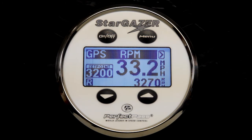The system has taken over. The RPM should quickly lock and hold within about three seconds of the engagement beep, and should hold ideally at 3200 to 3210 — it should hold on the high side. If it does this, it would indicate your linkage and installation were properly done.